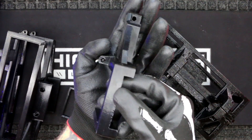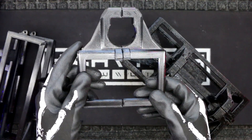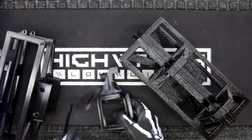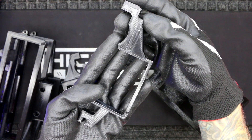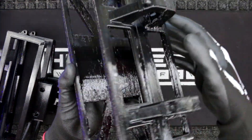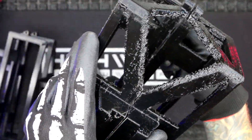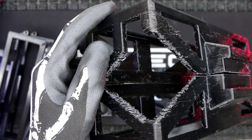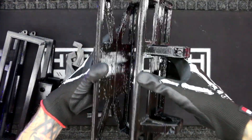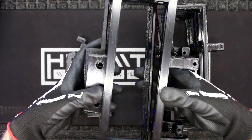It's really unfortunate that I dropped that piece because I did have two sections that were actually very good. My original testers and cross sections came out really good, and I think I understand why. Because this piece is so long, when I'm printing smaller pieces they're more towards the center of the bed where the heating element is. The further out from the center, the more chances you have of cooling at the extremities, so it's going to start bowing and warping. The 1.0 nozzle print is not pretty, but it is actually very strong and considerably more rigid.